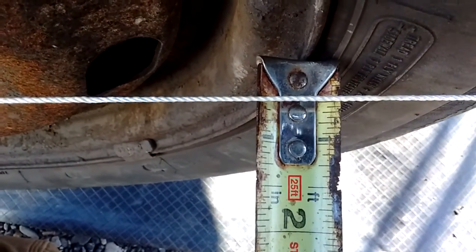So the back here is right around 1/2 inch, which is 8/16. This here, I've got it adjusted. It is now 9/16. So what you do is, here's your inner tie rod, and this is your outer tie rod. It connects with the ball joint, and you grease that.